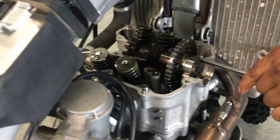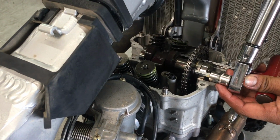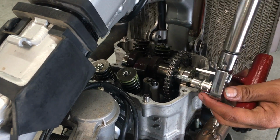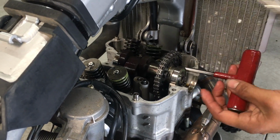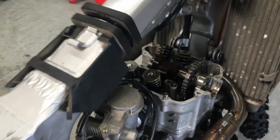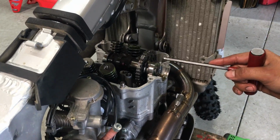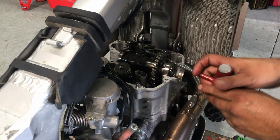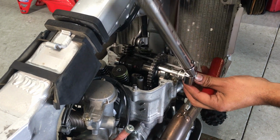I think I remember you telling me you can't just do the airbox mod, because it's kind of counterintuitive. When you're talking about cutting the little triangles in the screen, doing that adds about 1 horsepower, but you need to have all these other mods on it first. Now that you've put the cam in it, and you have a pipe on it, and it's jetted, and it's got the snorkel out of the airbox, then you could do the cut.